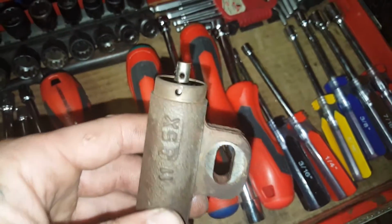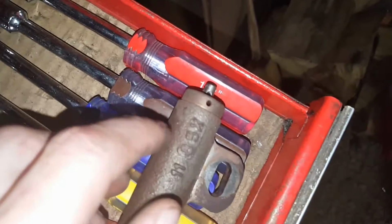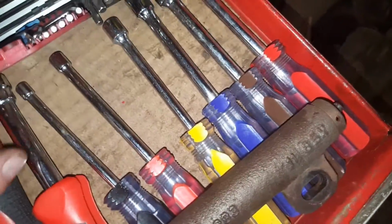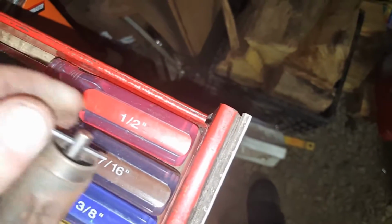Brad's takes a hydraulic tensioner. You see this little hole, we have to push this down with a vise. We'll stick it in there like this, with the words pointing up. Before you do that, you're going to want to find something that'll fit down this hole. Normally I just use an Allen key, or hex key, whatever you want to call these things. I'm calling them Allen keys, so nobody hate down in the comments. So we found one that fits. It's really snug and tight, so there's less chance of it bending. I like the Allen key because it has this little part you can just tug on and it'll pull out easier. So before the Allen key goes in, you stick it in the vise.